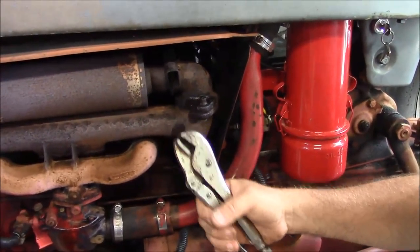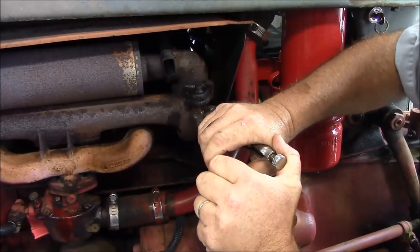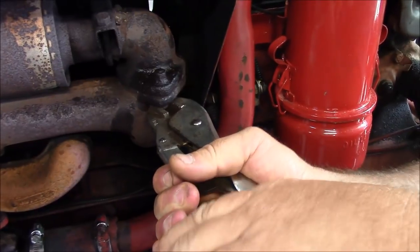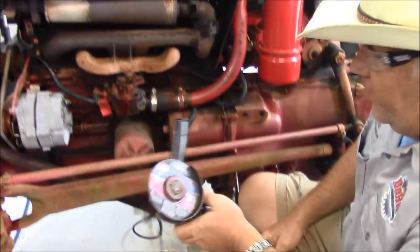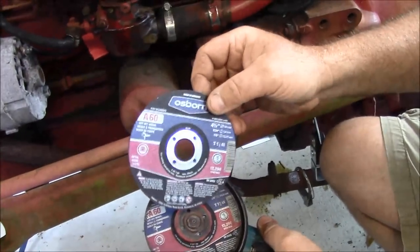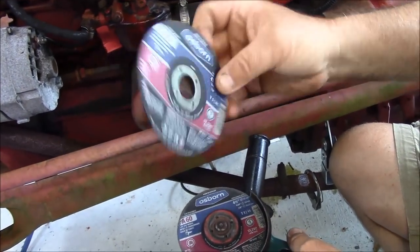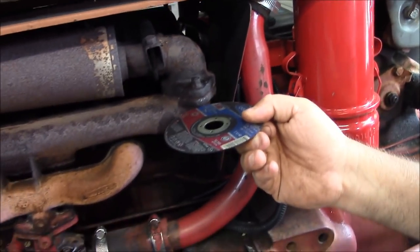So we're going with the pair of 10R vice grips. Due to heat and a lot of corrosion, the steel has become one. So we're just using a typical 4.5-inch angle grinder here with one of these Osborne wheels on it. I like these — they tend to last a little longer than the cheap ones, and the thing I really like about it is it's less than 40 thousandths in thickness and I've never had one come apart on me. It makes a nice tight curve to get under here. We're just going to cut this bolt right off there.